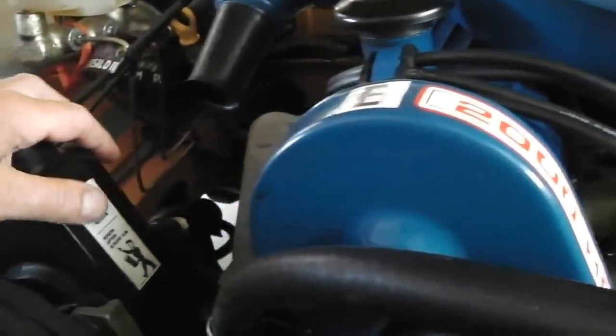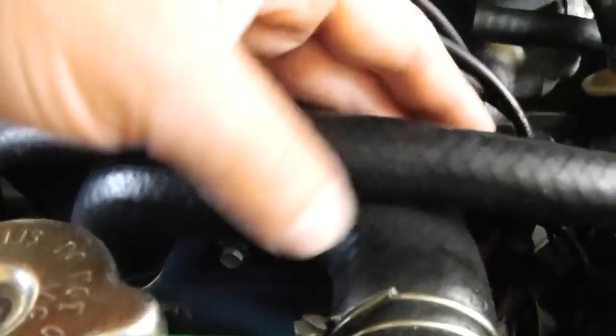But for me, trying to keep it original looking under here, now we know it's not totally original looking, because of the various additions. We've got an electronic distributor there and a few other alterations under the bay. I didn't want to have the controller box for the fan top mounted, although it is best to come off your top hose, there's no reason why it won't work on the bottom hose. It may perform differently, but it'll still switch in if I turn the stat to where I need.